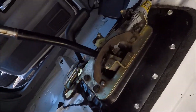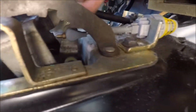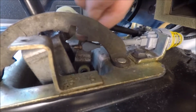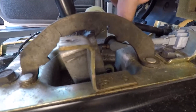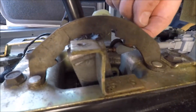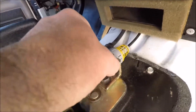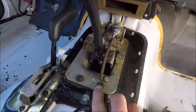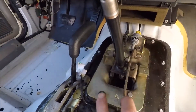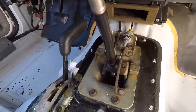The other cable disconnects kind of like a carburetor bracket. There's a little plastic piece — basically you can grab that and push it toward the back and it'll just pop off. Don't try to pop it off like the shifter linkage or you'll break it. It has a little hole in the back side shaped like a teardrop, so you push it toward the back of the vehicle and it'll pop off a little notch. Then these two tabs right here — squeeze those in and that'll come off. Just unbolt these four bolts, this thing will come off. These are exactly the same between the 96 and 98 — the footprint's exactly the same, so it'll just basically bolt right in.